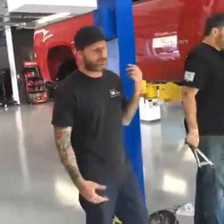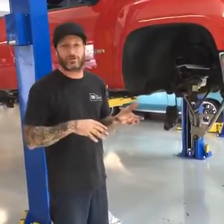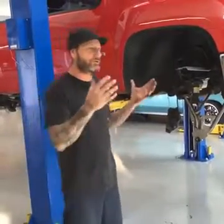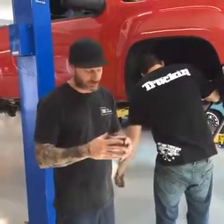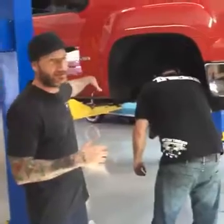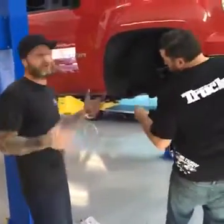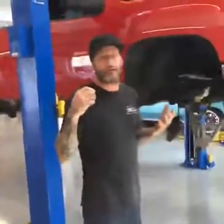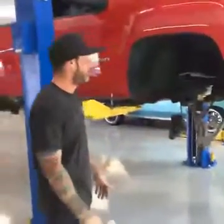For the rear? Yeah. Basically it's an overload bag. It's much smaller than an airbag you would use to lower and raise your truck. In the old days you used to have air shocks, and you put a load in the rear of the truck, or a trailer on the back, and you just apply air to this little airbag. It sits along the side of the leaf spring, or just under the leaf spring to the frame. Basically it's adding a little bit more pressure to the rear, so you're not bottoming out on a heavier load, or like I said, towing a trailer.